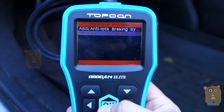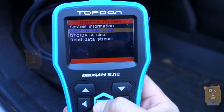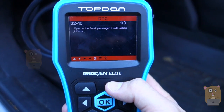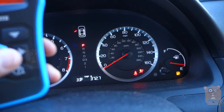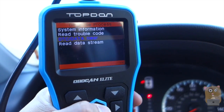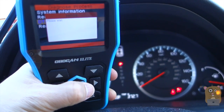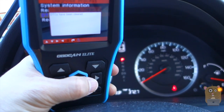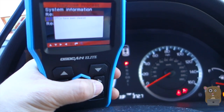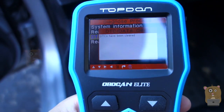For the SRS — in other words, the airbag — I'll read the trouble codes: front passenger side airbag inflator. For my vehicle, the airbag light is on, and I'm going to show you what happens when I try to clear it. I know why my airbag light is on and I have not resolved it yet. The light will de-illuminate and pop right back up — it's not like the check engine light where it takes a little more time. So I actually need to fix it before I can clear it.